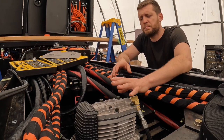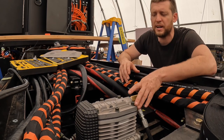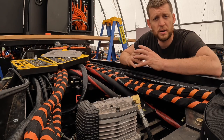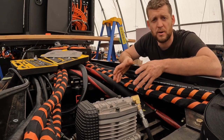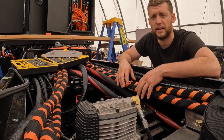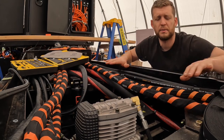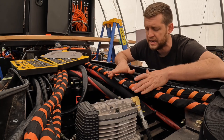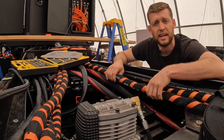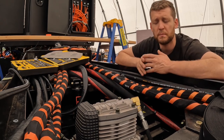I would like this air compressor in a side box — we just had extra frame rail space and thought it might be cool sticking it in the frame rails, see how it does. But the air filter could be moved. These are things we'll work with Justin and our 3D guys on — placing into the drafting model and changing things up. This is part of prototyping: you build it, put it in, see how you like it, test it, then move things around. The cables currently run under a walking plate and we're putting a deck over to protect them. On this prototype truck we're leaving things in easier-to-access spots for maintenance, and as we go into production we'll move them into more protected spots.